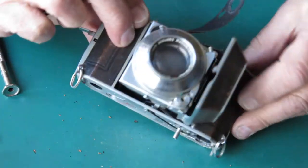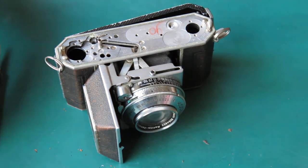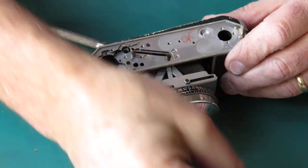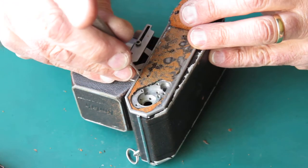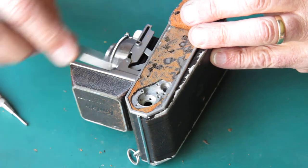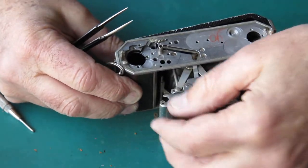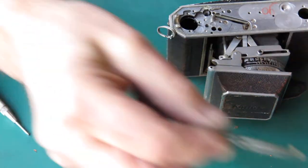That deals with what needs to come off the body directly. Just take the door off the front. Hinge pin screw top and bottom. Maybe one or more spacer washers between the door and the frame. There's one at the top. There's another one that was at the bottom.